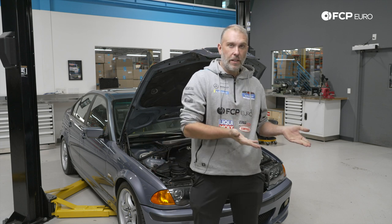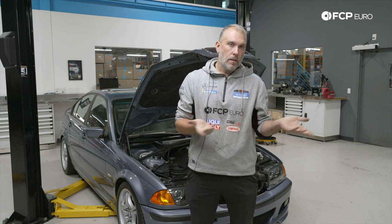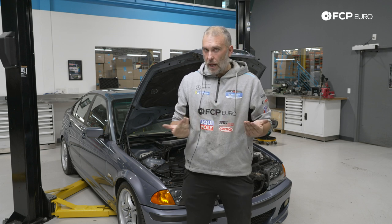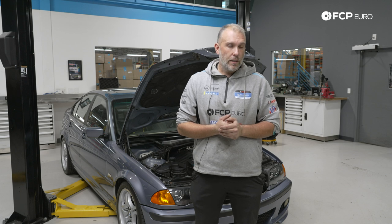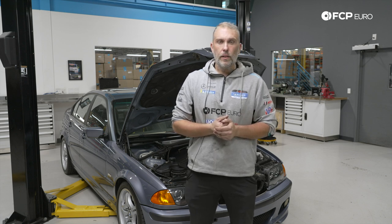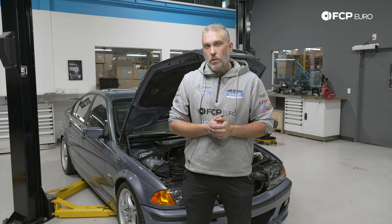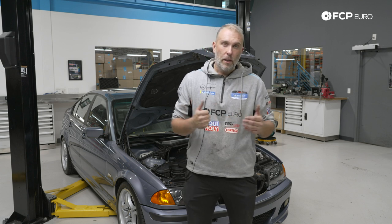That's how you go about replacing your engine mounts and transmission mounts on a rear-wheel drive E46 — whether it's S54 swapped, an E46 323, or an E46 M3. The only difference is the Vanos pressure accumulator on M3 or S54 cars, which is just one extra bracket. The only real trick is that right engine support bracket — it does need to be removed from the engine block to gain enough room, though you could drop the subframe as an alternative. Dropping the subframe is actually more difficult than just removing those four bolts. If you have any questions, leave them in the comments below, hit like, and subscribe.